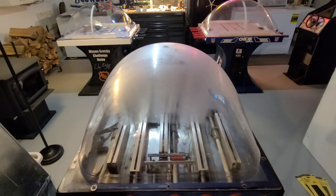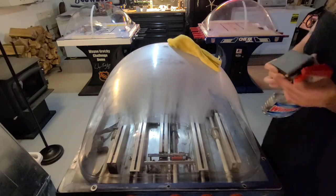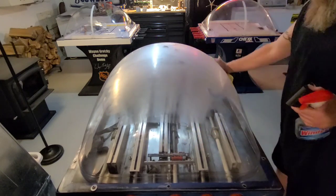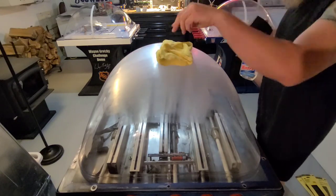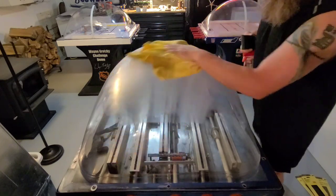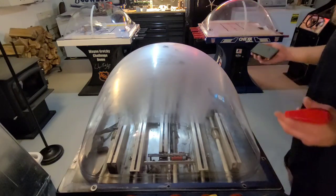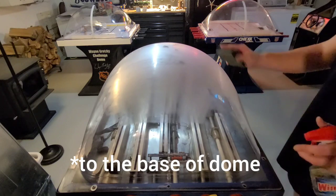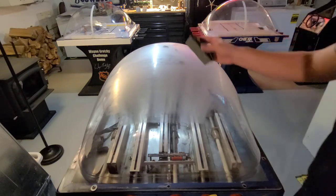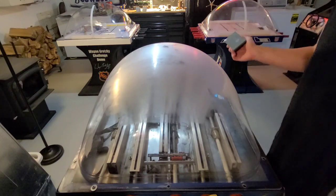I know you've got a lot of money invested, but don't worry — it's going to be nice and shiny in no time. Another key between grits: you really want to wipe off all the stuff you just sanded off. Really key to do that in between grits and between polishes — just wipe it off real good in stages, get all the residue you just removed, then reapply the water or wax for whatever stage you're on. Going from 800 to 1500, you're starting to get more of the base; around 1500–2000 you'll be doing the whole base. If you have to sand your base, you're probably going to have to do the whole thing around 2500 grit.